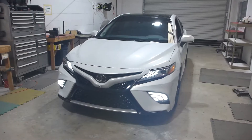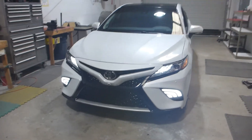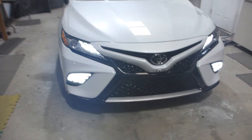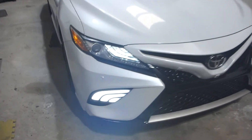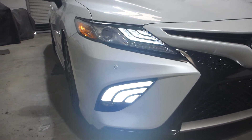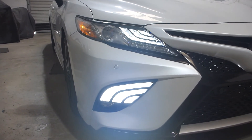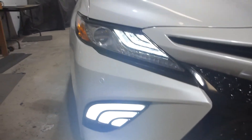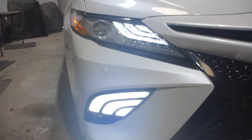So let me show them off. For the record, I did not use the wiring harness — the relay harness that was included with these things. I just make my own. What I did was I tapped these running lights right there into the parking light circuit up above using a three-pin JST connector, so it is still serviceable. As you can see, the white matches fairly decently.